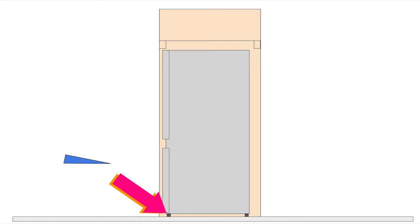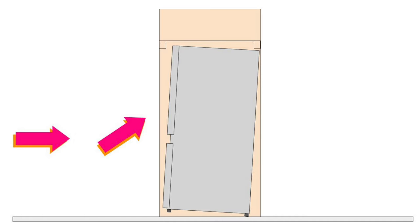I'm hesitant to pull the fridge the whole way out. So I need a solution that will allow me to tilt the fridge back without pulling the whole fridge out of its little alcove section. A friend of mine had the idea of making a little shim, a little wedge to go underneath each foot, and we can see how that fixes the situation. If it doesn't, I could easily make another one to fit on top and keep increasing the angle by adding more wedges. We'll see how unlevel we can get the fridge. If we can tilt the fridge back far enough, maybe then it'll finally work and allow the door to close properly.